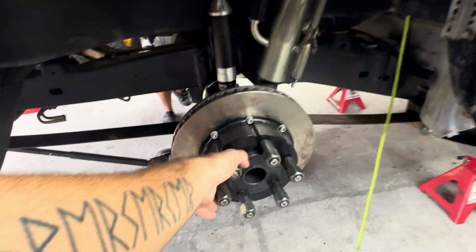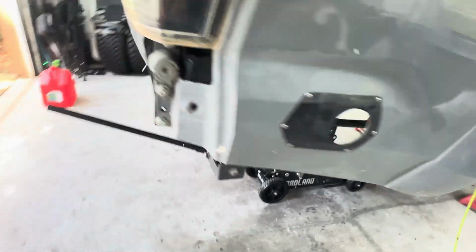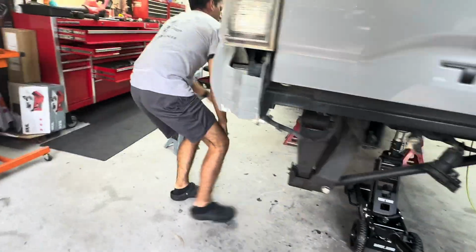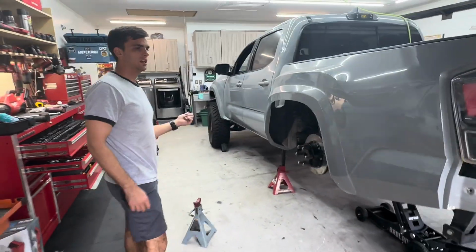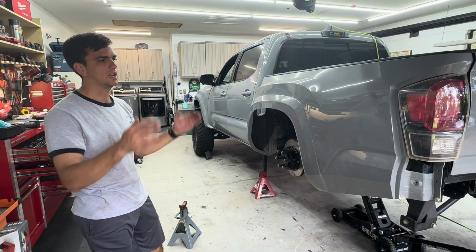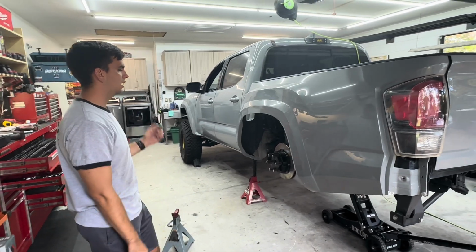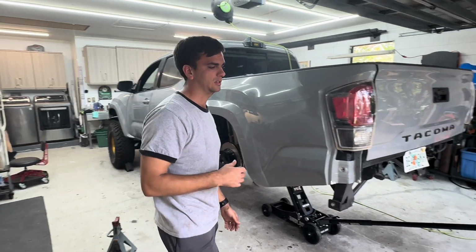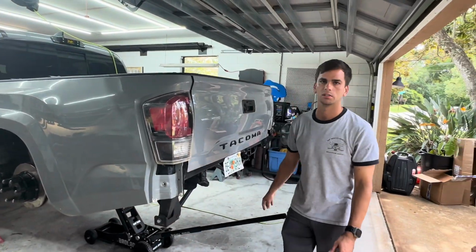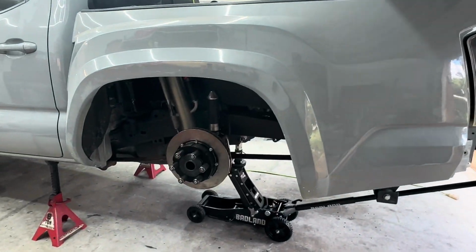But wow, full floater, everything fits, everything rotates perfectly. I have to just put the axles in, do some brake work. Just with how big that drive shaft is, how thick it is, I couldn't make anything above it to still support and make a cross member there. So like you were saying with the cage, it's gonna be perfect with the cage. It's gonna be plenty strong without that little cross member in there. And the metal on that cross member was really super thin.